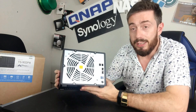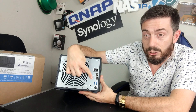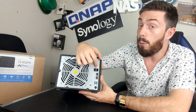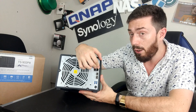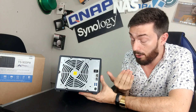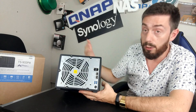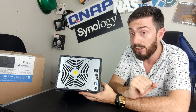Why use SSDs for raw storage? Because this device arrives with support for 10GbE over two ports — so up to 20GbE link aggregation — and two 2.5GbE ports, so 250MB/s or combined up to 500MB/s transmission. You can create a very bespoke network environment, utilizing these ports independently for different networks as a failover, or use them on the same network with a supported LAG switch for link aggregation.